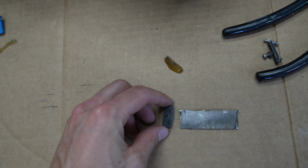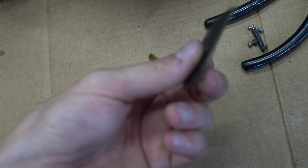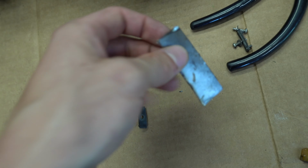I'm gonna drill these out, bend them over, and I think we're just gonna spray them with like Krylon or some kind of junky spray paint from Walmart. So this is gonna go great. As far as the first bend's gonna go, I'm just gonna need to have the bend be that deep, and then we're just gonna bend this one piece flat back, and we're gonna worry about one big pilot hole here, and then on that 90, we're gonna drill a hole facing inward so it can tighten up onto the back of the light and basically just be bent down like this. So fairly simple process. I'm excited. How about you?